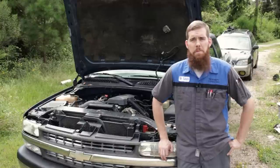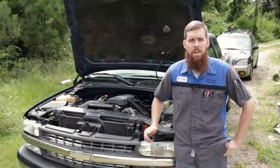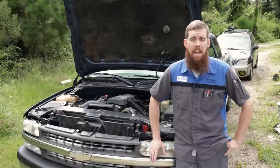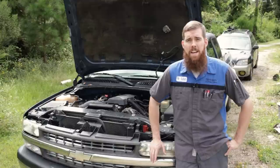I think it was $800 from LKQ for a salvage 5.3 Vortec. I believe that engine had about 60,000-70,000 miles on it. So no issues up until recently. They've been complaining of poor acceleration, poor power. Check engine light is on, scan the truck. Can't remember all the codes in it, but the main code, what we're working on today, was a knock sensor code.